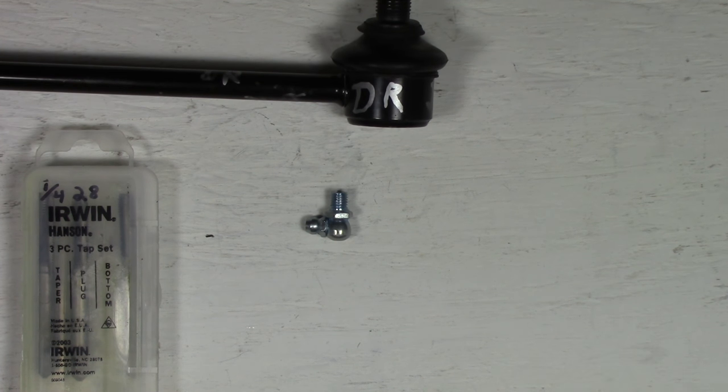And then I can put my grease fitting, my gun on this stud or this fitting, no problem at all. So again, orientation is important. Make sure you get that right. Make sure you just put the piece next to the current piece prior to putting it on, and making sure that you got the right angle on that.